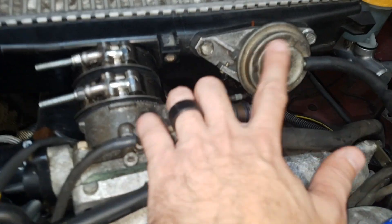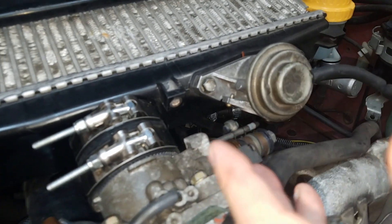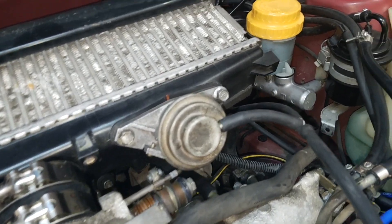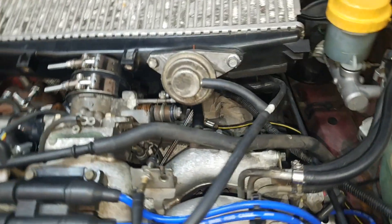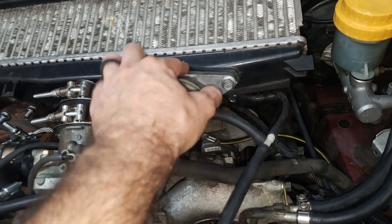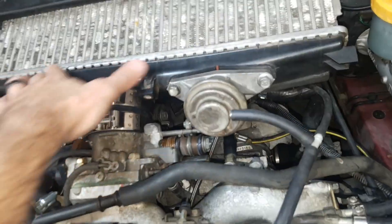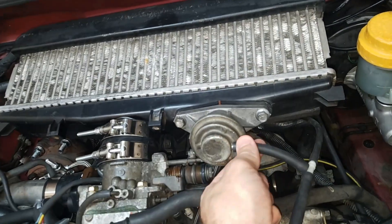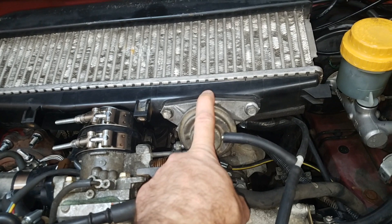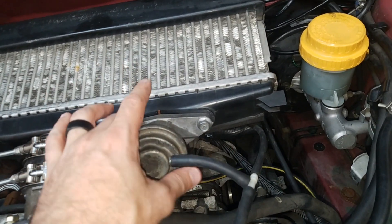With the blow-off valve, again we're vented to atmosphere. Normally this would be running back into the intake — we can't do that. You may not even use the stock blow-off valve; you may use an aftermarket one that's still vent to atmosphere. If you're using a vent-to-atmosphere, what happens is this vacuum line right here pulls kind of on the spring that's inside. There's also vacuum coming from here, but this vacuum is going to be a little harder because it's more direct on that. So it's going to actually pull the spring open slightly at idle, and when you're actually driving the car it kind of offsets, so the valve actually isn't open.